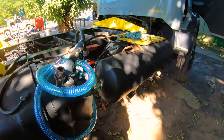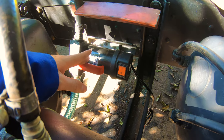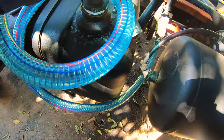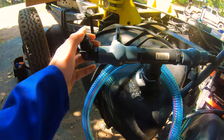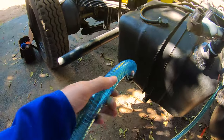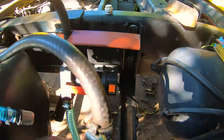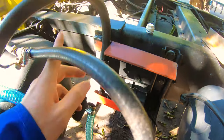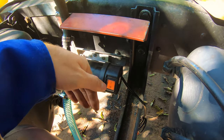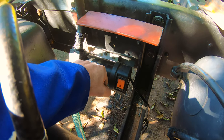So we ended up buying another pump. This one, you don't have to gravity feed it and you don't have to prime it. You can just put it straight into the container. It'll suck up air as well as fuel. Of course, I've got my valve that will let some air escape. But the idea is just to take the pipe out. It's actually got a nice little filter at the front. I pop that in the container, switch on this little switch, and then that'll pump into the tank. We'll add some hinges. It'll have a little flap that closes up and that locks from the bottom so that nobody can actually steal the pump off the fitting.